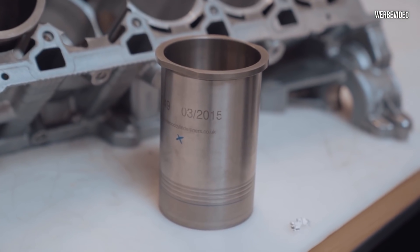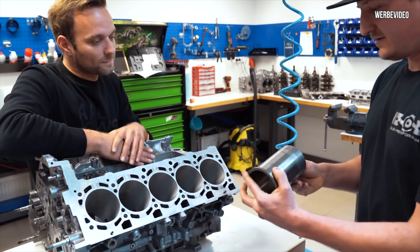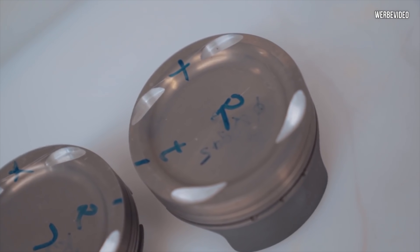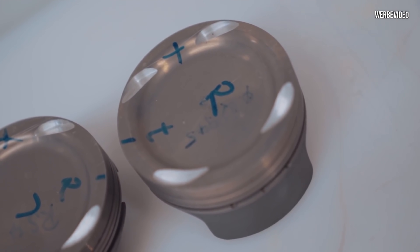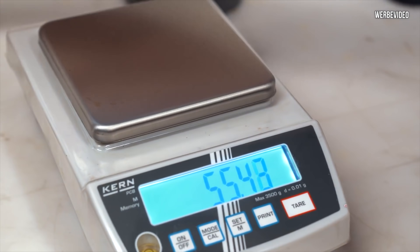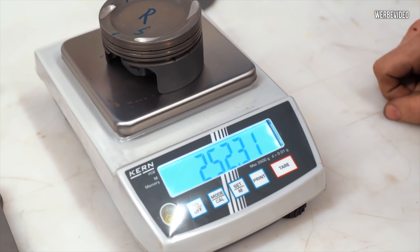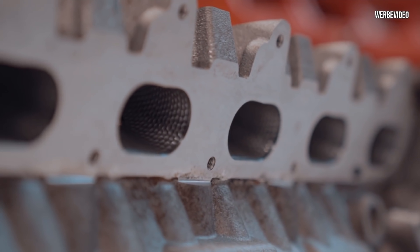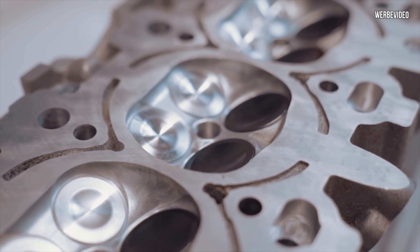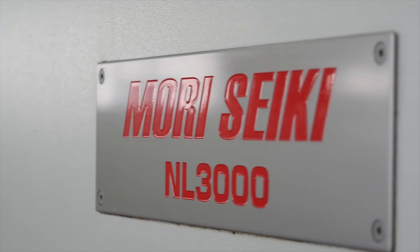These are the new sleeves for this engine. The owner is a German YouTuber, Philipp Kaes. These are Mahle pistons — the weight is super. We use aftermarket connecting rods. The heads are already ported from NG Motorsports and the combustion chamber is CNC machined with a Super Tech valve train.